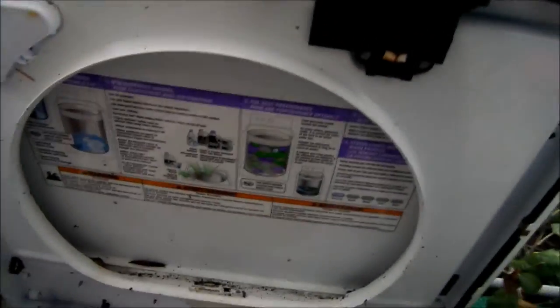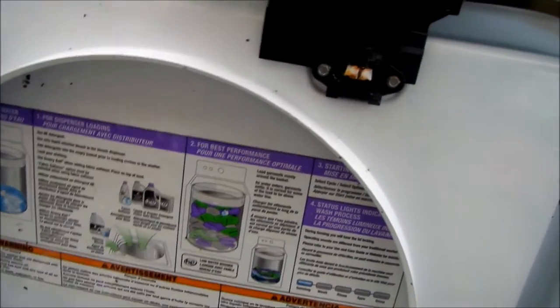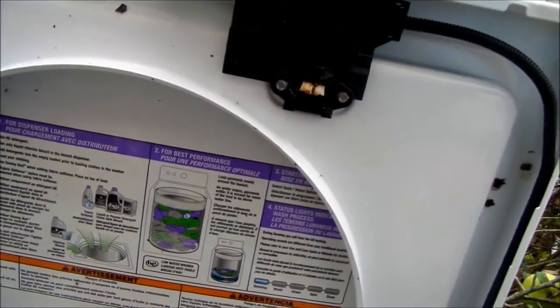You can see how that is. There's a little tang in there that catches it. So you have to push it so that that tang comes loose. So this one's got to come back just a little bit in order to come up. And once we've got it up here, then we could take a look at the lid switch. So this lid switch here definitely is going to need some work.